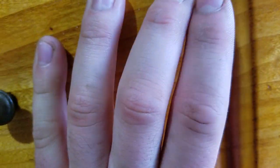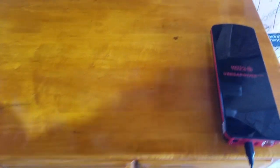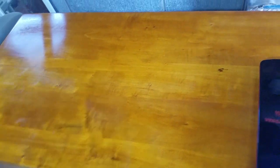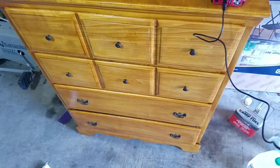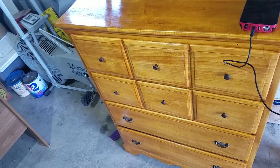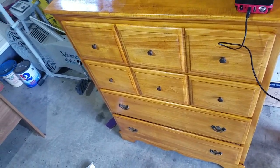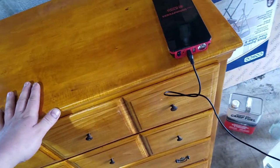You can't really see it here — the color doesn't look quite right in this spot. I may try to touch that up; I think it's just a dry brush stroke. For the most part I'm happy with it. I spent about a day and a half working on it, from sanding all the old finish off to reapplying. With this stuff you have to wait at least an hour, then sand it, then recoat it. There are also supports for the drawers in there — a couple of them are a little bit loose. I stuck the drawers in to save space, but I need to take them back out, drive a couple screws in, and add a little wood glue to really sturdy it up. This thing is almost ready to put back into use.